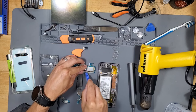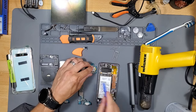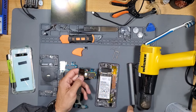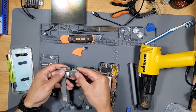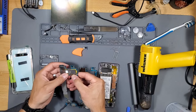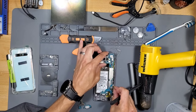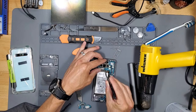Okay, now we've got to switch everything over. The sensors, the cameras, and the headphone jack have to be swapped over, but it's really easy to do. These connectors look good, so we're going to plug them in — put the bottom in first. Be sure to pull out all the ribbon cable connections before seating the motherboard in. I'm using plastic tweezers instead of metal tweezers because the ribbon cable connections can be delicate and may rip.